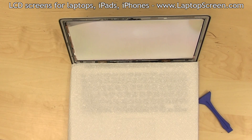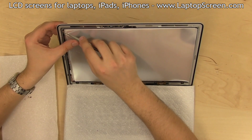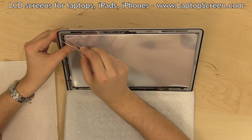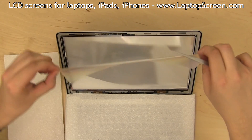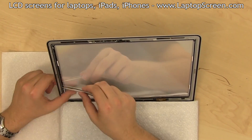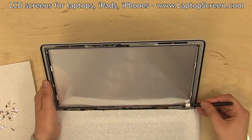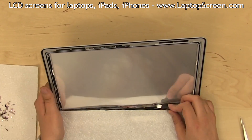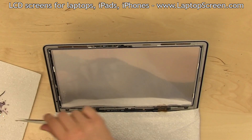Next, the mounting edges have to be fully cleaned up. There will be a lot of tiny pieces of glass on the edges, and we recommend using tweezers and a scalpel to effectively remove all the glass while leaving most of the glue in place. Set the top diffuser aside once it is free from the broken glass. Spend as much time as necessary to clean up the edges, and ensure to collect all the broken glass for disposal.